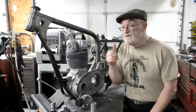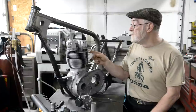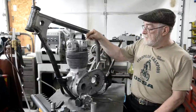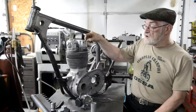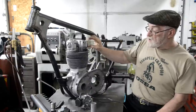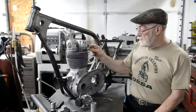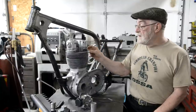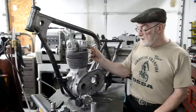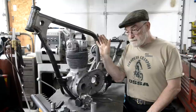I mean, I did that with the Enfield. Didn't do it with the Triumph, but I think we will with this. So I've got some more, what are these? Quarter inch BSF screws. I went around and measured everything I needed for the cases, so they arrived. And some 5/16 BSF Allen bolts, I think they're 1 inch, 3/4 inch, something like that, to actually mount this manifold. So let me gather all the bits together.